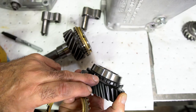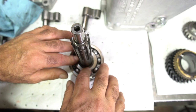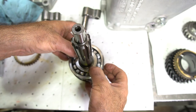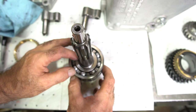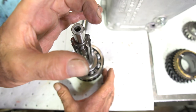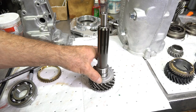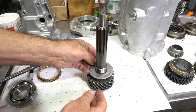The next step is to put the input shaft bearing on first. Some bearings may slide on, some may need to be tapped down — you can heat the bearing up and slide it in place, or press it in place, whatever works for you. You just don't want to beat the hell out of the bearing. If you're going to use a punch, make sure you gently punch down on the inner race, not the outer race — always press on whatever race is taking the press fit. Also, everybody always asks about oil slingers: they go on with the protruding inner edge facing towards the front, not backwards.